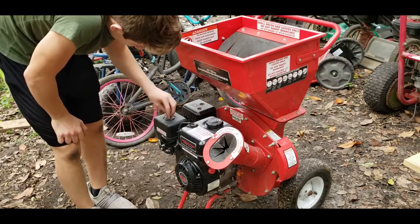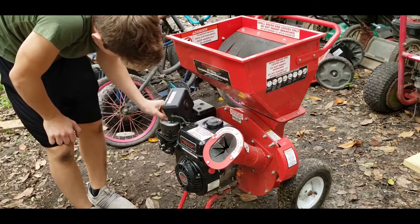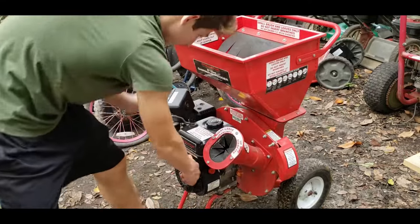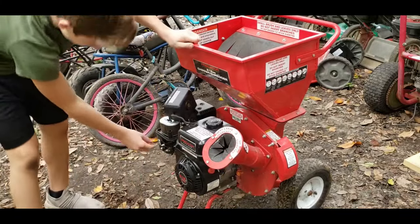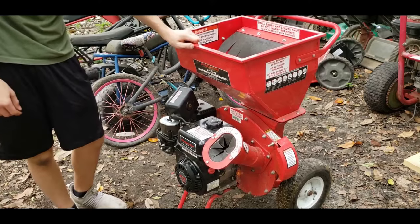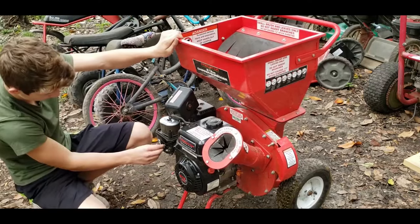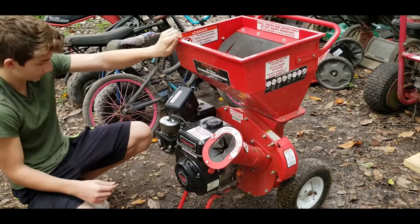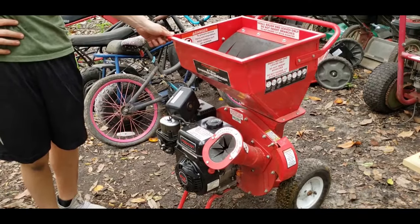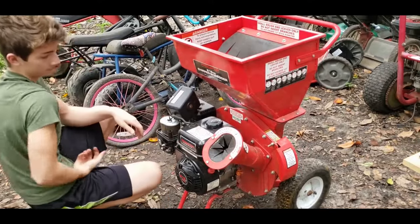Right here I'm just taking the air cover off. This is a test to see if the engine will start with more airflow. I loosened up the air filter as well to give a little bit more airflow. We're about to test to see if it starts in the start position. You can see when I started it up and changed it from start to run, it died down — that is 100% a sign of a bad carburetor. So we're going to go ahead and clean that now.